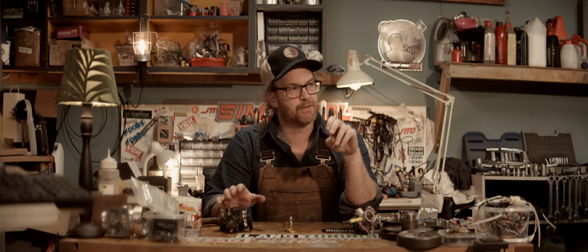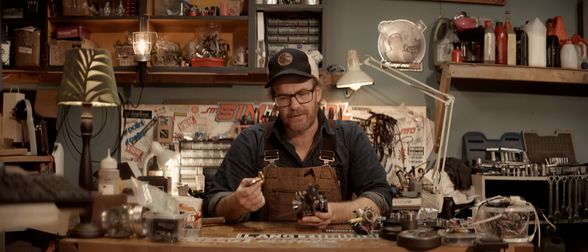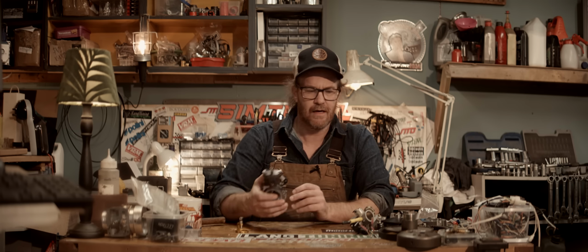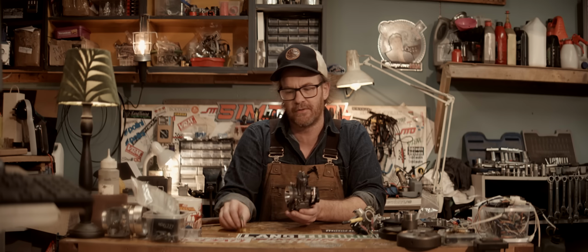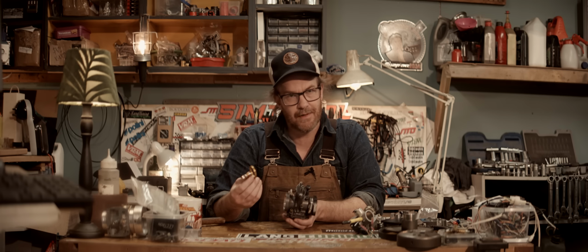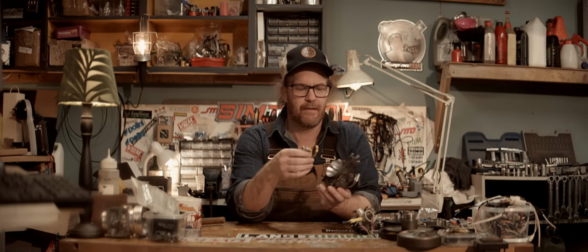So our goal is to cram as much nitromethane as possible into the engine. I think we should go back to our first test, but this time use a proper injector. Before, I had like an oil feed thing going on, not controllable at all, not high pressure, not vaporized, anything like that. So that's the plan for today: go back to a nitromethane injector into a carb.